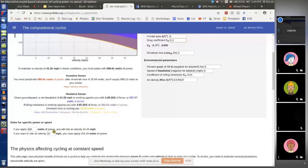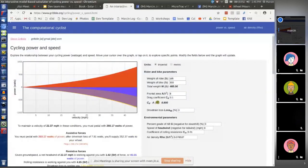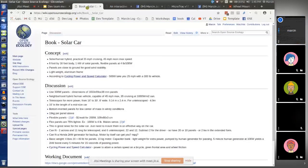So it's worth trying. This thing of solar cars might not be a bad idea, but think of a telescoping body on that car so some more panels would slide out. So you could say get 50% more power. Maybe you get that all up to 1,000 watts of power. Well, you're talking about 50 miles per hour at that point. So, you know, think about it. Maybe solar cars could be feasible. And this is just getting off-the-shelf current PV panels. It's a thought that should be considered, because if you look at the numbers, the first principle calculations get you pretty positive results for solar cars. Now, granted, the Sun Race, the solar car race across Australia, those things go 55 miles per hour just on solar power. So, you know, might be worth considering.